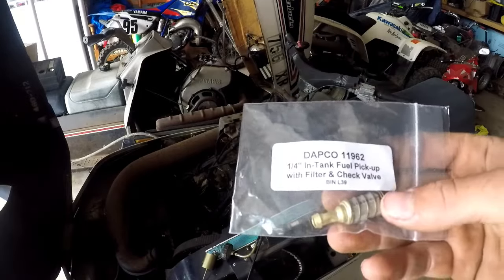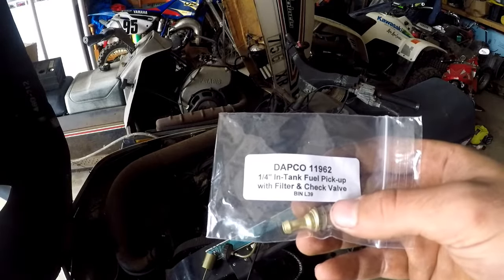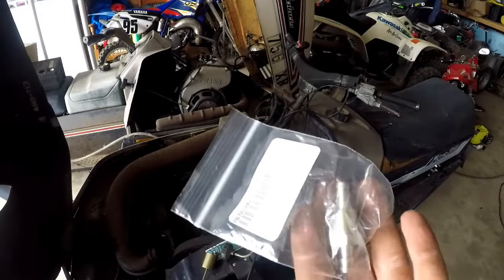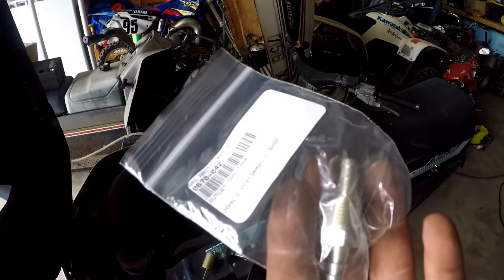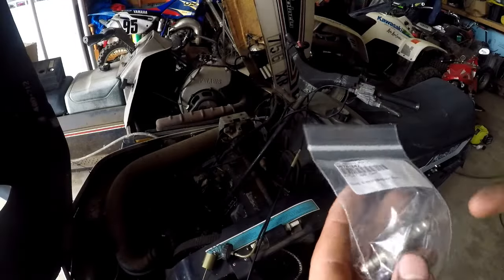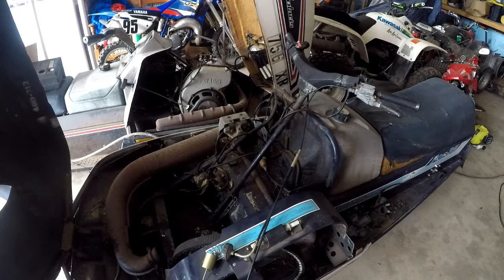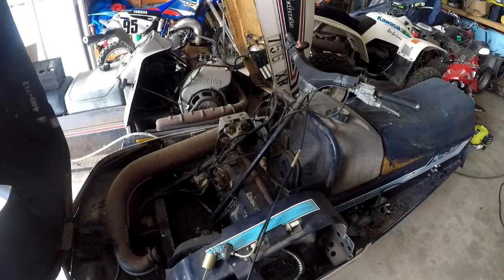They're like eight bucks. There's a part number you guys can see on there. This came from eBay for like eight bucks. I don't have one in my tank right now, so I had to order this. This is actually an Arctic Cat part, but it's the same threading I believe. I'm probably going to put some Yamabond crankcase sealer around the threads because it's fuel and oil compliant — it won't eat through it — and it's also tapered, so it should seal up very nice.